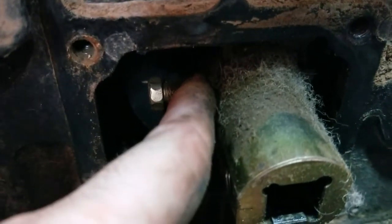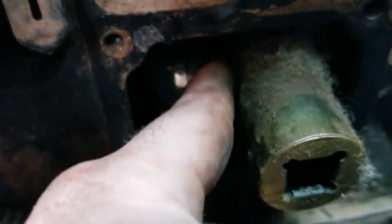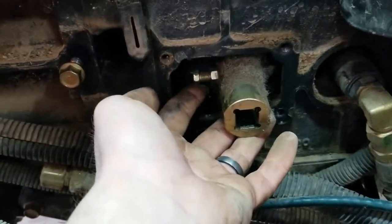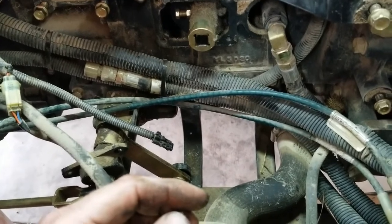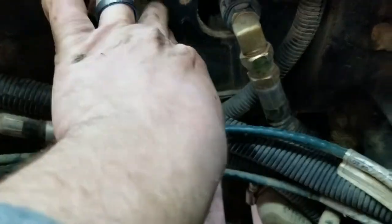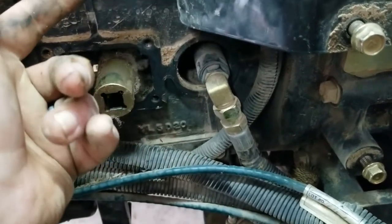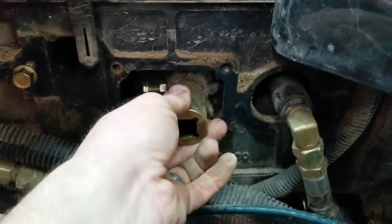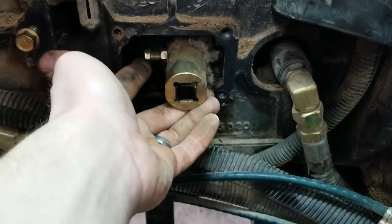It's not a welded nut — you run the bolt down and then run the nut into it as well; it's threaded on both ends with a kind of stopper nut. You can adjust it by backing that nut off and driving the bolt forward. There's probably enough room to do that without disassembling the whole tractor, but I couldn't see it and the service manual diagram was less than helpful. I'm going to clean this out — looks like maybe a mouse nest — then tighten this bolt up and get some of that slack out.